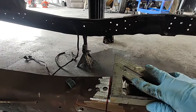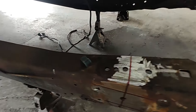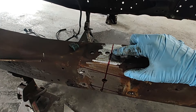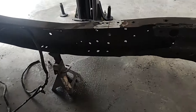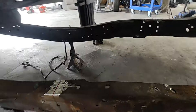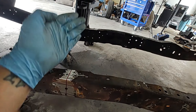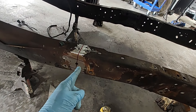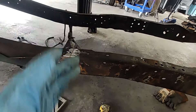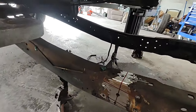Some stuff to check — when you put this, this thing could be twisted a little, could be forward or back. You can see this top hole — we're back maybe about an eighth inch from it. Look on the other side, about an eighth inch back from it too. So we know everything's going to be good and square. Our lines are matching up on both sides, lining up all the way across the top and the bottom on both sides.